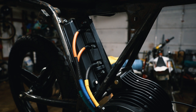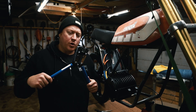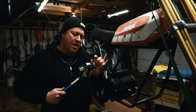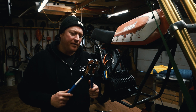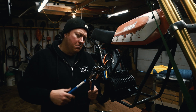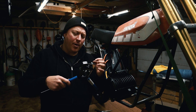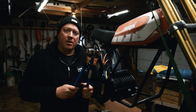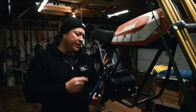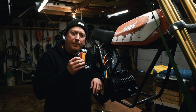All right, we've got our phase wires. I got all the phase wires shortened — they're connected correctly. The crimper was a little funny. I feel like the size isn't quite accurate for the terminals. It did work fine, but I had to play with it. I did a larger size and then a smaller size instead of just going to the right size. I'm going to use these again for the battery terminals. I'll put a link in the description where you can get the terminals, the crimper, the cutter, and the shrink wrap.